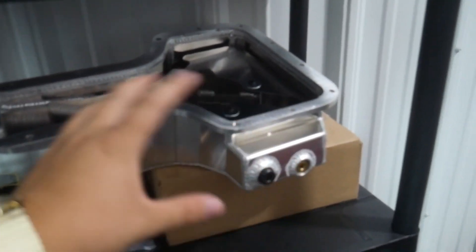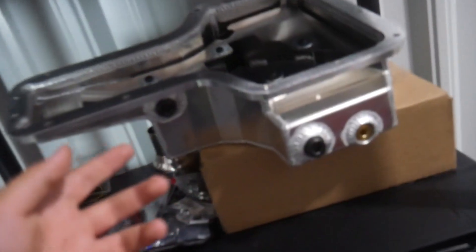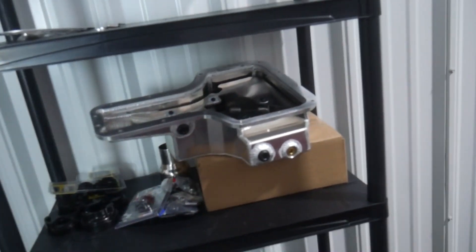It is now time for an oil change on this car, so I'm going to go under there, drain the old oil, and see where it's leaking from. I'm really hoping it's just a leak from the drain plug. I've actually got another one of these Moroso oil pans here for the blue Corolla — you'll see why in the next video. Basically I'm hoping it's either going to be a leak from the drain plug or from either of these two bungs. That would be the ideal situation because then all I would need to do is take these plugs out, put some thread sealer on there, and put it back.